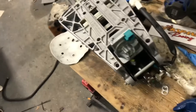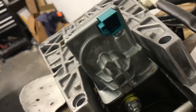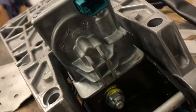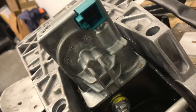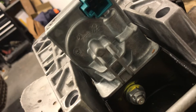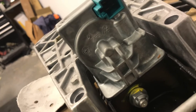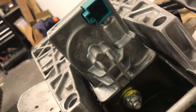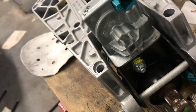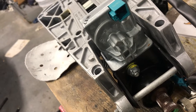What up YouTube, Mr. Random checking in. Today's video I'm gonna show y'all how we unlock this steering column ESL lock when it's in a locked position. I'm gonna drill a 1/8" hole — I watched a couple guys' videos — drill it right in this corner with a 1/8" bit, and I'm using a pick to be able to unlock it. It's in a locked position so I can't take the ESL lock off until I turn that gear. Stay tuned, let's get it.